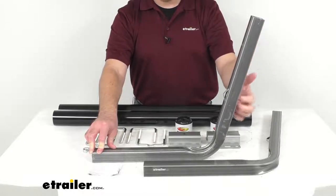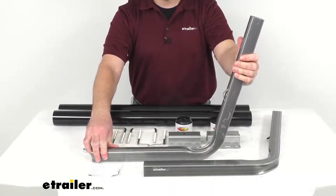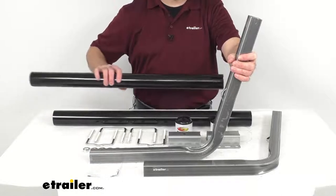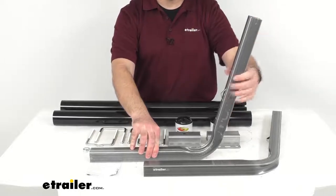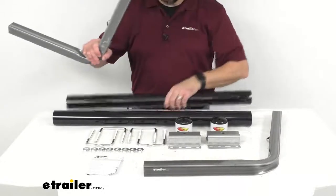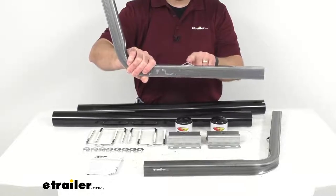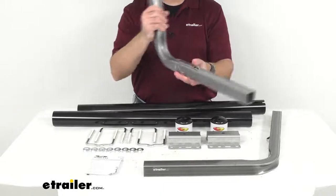These square 16 gauge pre-galvanized steel posts are strong and durable, and the black PVC pipes simply slide over them so you can see your submerged trailer. The posts are 18 inches tall and an inch and a half in diameter, and the PVC pipe is two and three eighths inches in diameter. The posts have a no-rotate notch on them to ensure that the PVC tubing will not rotate.